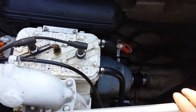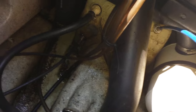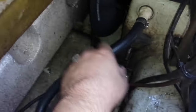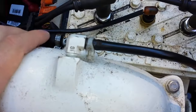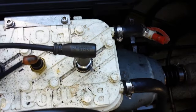What you want to do is find the intake cooling tube or hose. On the older motors it's pretty straightforward to find them — here it is right here. It comes in way back here. This is the impeller housing. What happens is the impeller pressurizes the water, and there's a little port down there that allows the pressurized water to squirt up into this tube. Then it goes around through the actual head — part of it goes into the exhaust and the rest gets ejected out through the drain port in the back of the Sea-Doo.